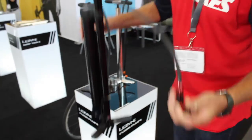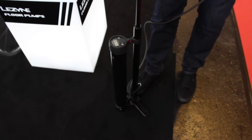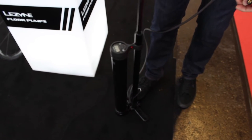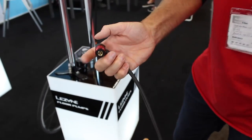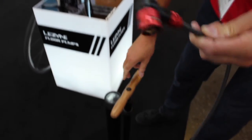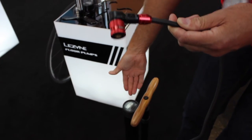What you do is start by loading the chamber with the foot piece up, then you start pressurising the chamber, keep pumping until you've got the main chamber right up to around 200 psi. You can't over-pressurise it because it's got a blowout valve. For speed purposes I'm just going to go to around 50 psi. Then you attach the ABS chuck onto your valve by pushing forward and a quick twist, and it's attached. Then you just push this lever down and all that pressure inside the main chamber is released into the tyre, seating it quickly and perfectly onto the rim. Done.